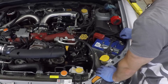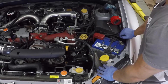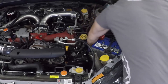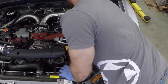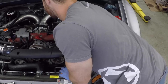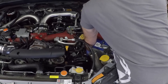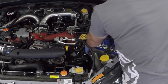I'm pulling the coils out of the head. What I found is that the front cylinder comes out pretty easily, but the rear one can be a pain - it does not just pop out. What I found is if you pull it out and twist it 180 degrees counterclockwise, it will come out. So basically flip the entire unit over and then pull it out. Otherwise you're going to be trying to jack up the engine to get it out. Counterclockwise 180 degrees and it will come out.